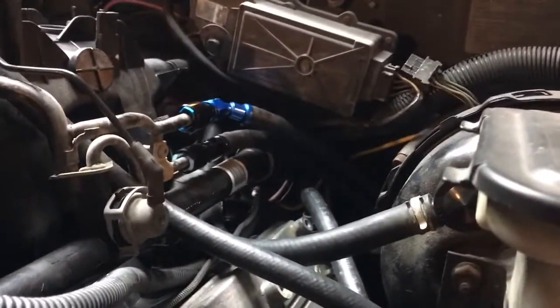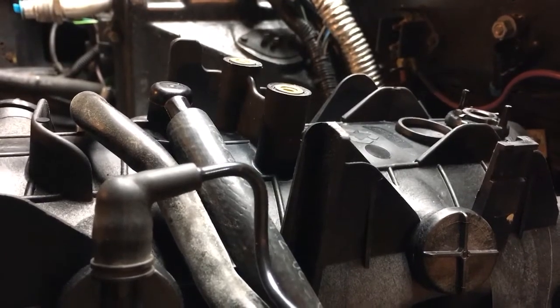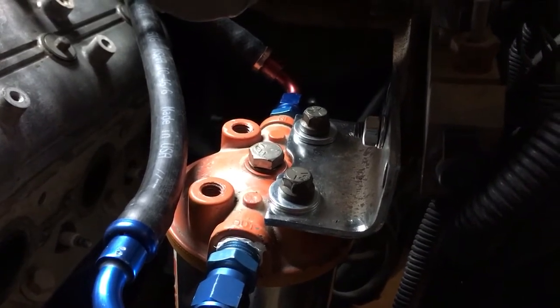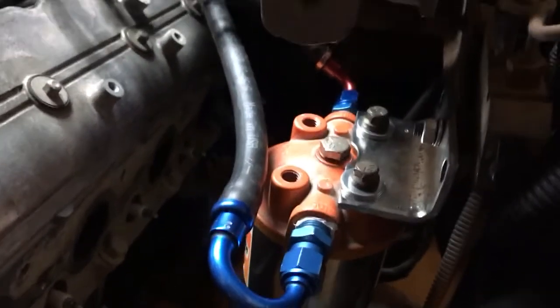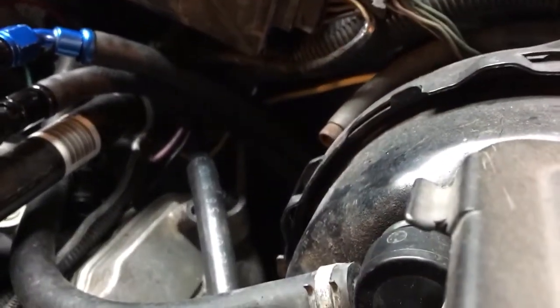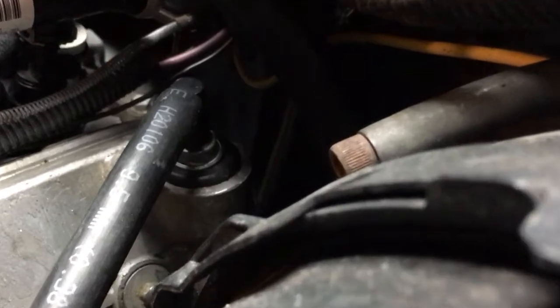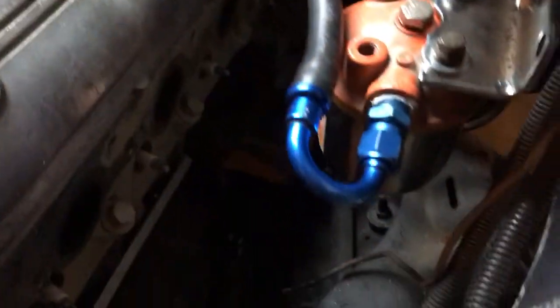I'm free-handing so I apologize if it gets too bad. Basically I have a hose that connects right here at the vacuum source on the top of the intake. It comes down and feeds into the back side of that filter — this was the least restrictive way I could set it up without too much bend on my hoses. It comes out of this side of the fuel filter, back to a 90-degree PCV valve stuck into the valve cover. I've got a 90-degree PCV valve right there — comes out, goes to the separator, and the line goes up to get the vacuum.